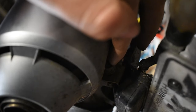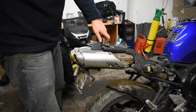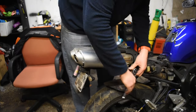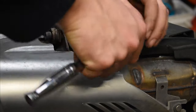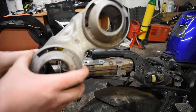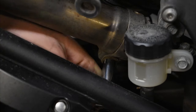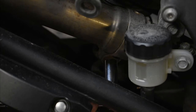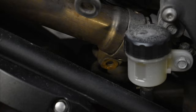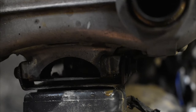Remove the bolt here and pull back that cover from the grommet above it. These two bolts along with this middle one will remove the heat shield section, and also unbolt the exhaust itself. There are two more lower link bolts holding the lower frame registration plate holder. Once you remove those, you can take away the heat shield and pull away the exhaust. Loosen off the clamp — I took the bolt fully out for more wiggle room, though it's not strictly necessary.